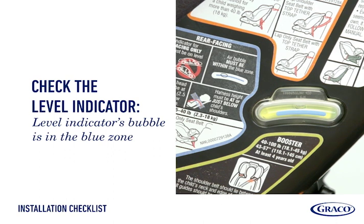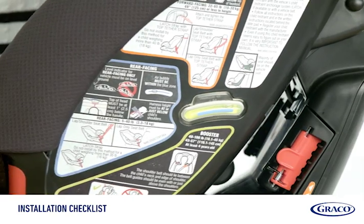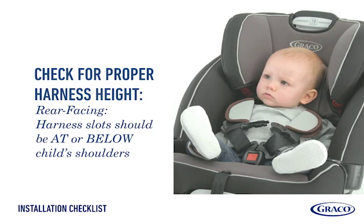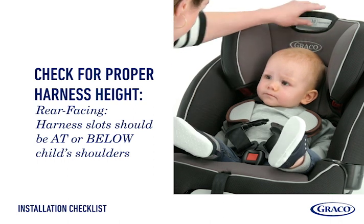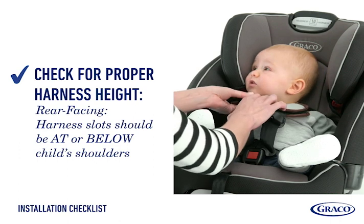Check the level indicator again to make sure the bubble is still completely in the blue zone. If not, adjust the on-the-go recline until the bubble is within the blue zone. Check the harness. For rear-facing car seats, harness slots should be at or below the child's shoulders. Raise or lower as needed to ensure the harness is in the right position.